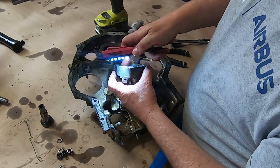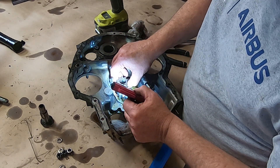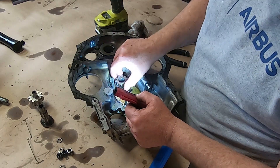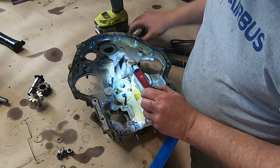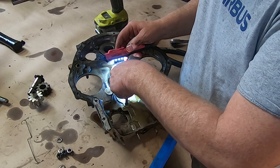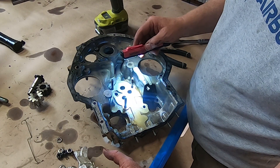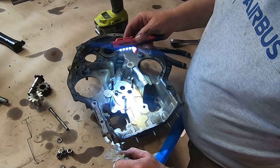That housing has a couple little scuffs — you can hardly catch your finger on it, so we'll take a look at that. This has one steel gear and one aluminum gear, and I believe these will be replaced with new gears because I don't believe they're airworthy anymore. We'll end up getting two new gears — a gear set and a drive shaft. But everything else looks good; this area here looks good. Doesn't look like there's hardly any wear at all. You can still see the machine cuts from the original machining. So that's removing the oil pump. Here's the push rod for the fuel pump — we've got to make sure we put that back in, otherwise that's going to be a problem.